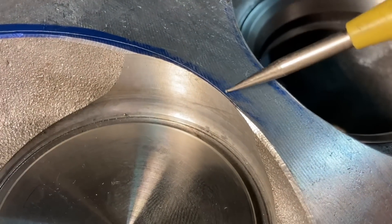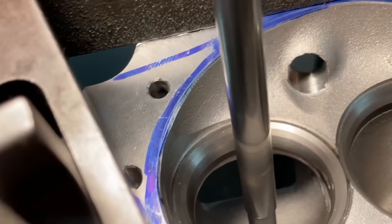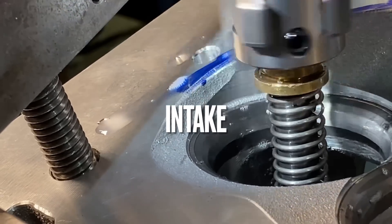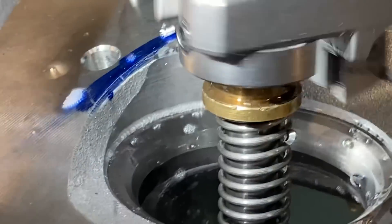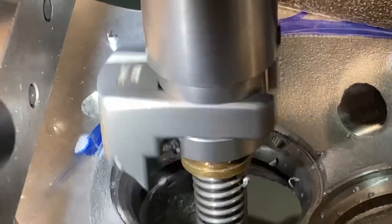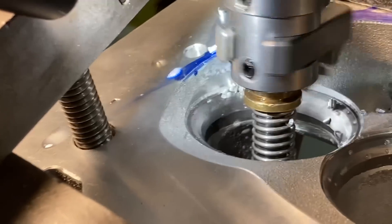You can see we got to our scribe line of the head gasket — that's it, that's maximum. The rest will have to work by hand, but you can notice how far we are off that wall. We're just getting our first cut up here, and we're watching for our contact line — we're right inside the contact line.